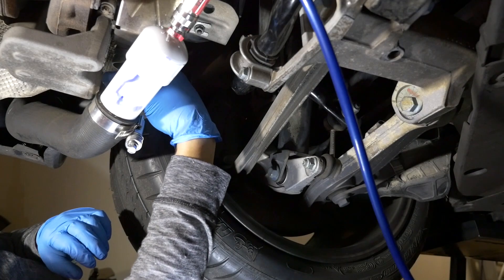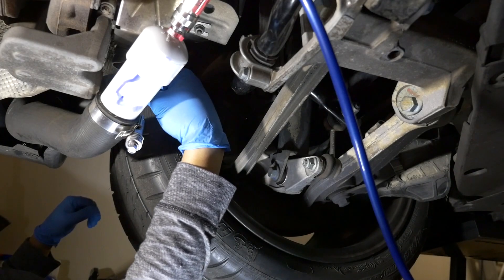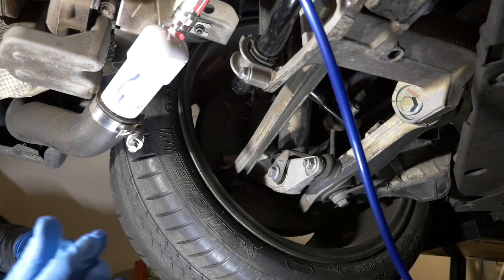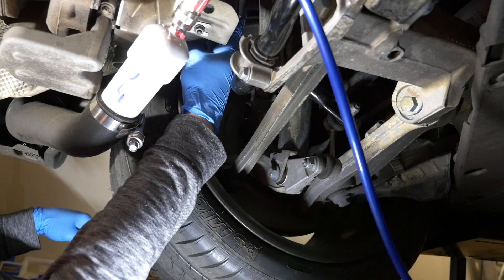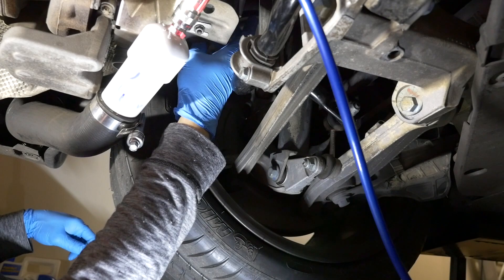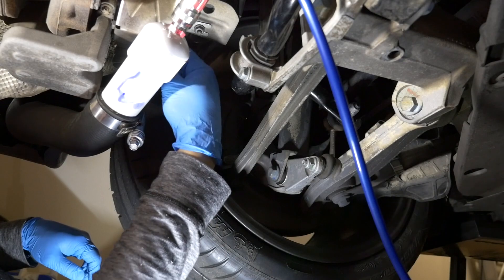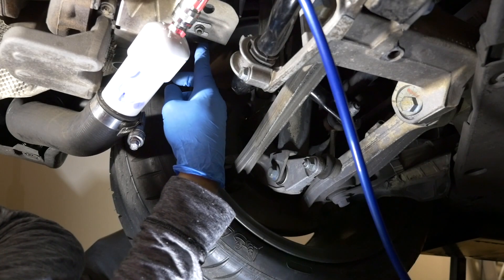I'm suspecting it's the VRV bypass recirculating valve — the diaphragm, I think, is leaking. With more air you can clearly hear it escaping. I had it regulated to very low pressure, but now I'm turning it up, regulated to 15 to 20 psi. The air is coming out of there. I disconnected the vacuum line to the VRV valve — it's supposed to work by vacuum, but when you pressurize it, the air goes to the valve, and the valve should be shut. But it's not — the driver's side is leaking, the passenger side is fine.